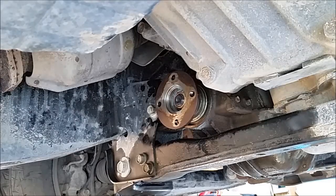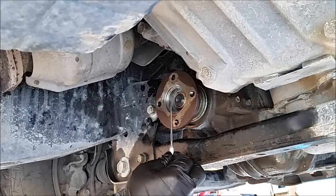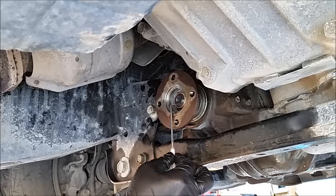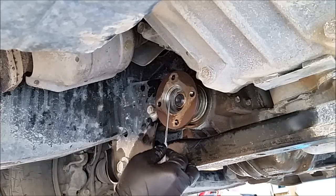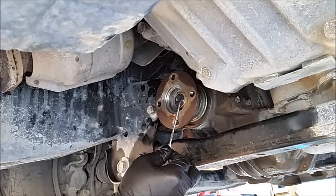Okay, I ran that down with a ratchet. Got the pinion nut installed. I went down a little way. Remember earlier I said we got the lines all lined up. There's a line right here on the tail shaft, and then there's a line that's on the nut. And we got three threads that we're showing.